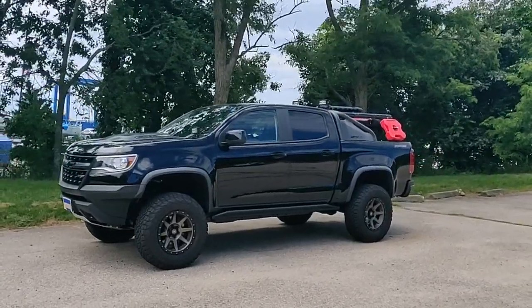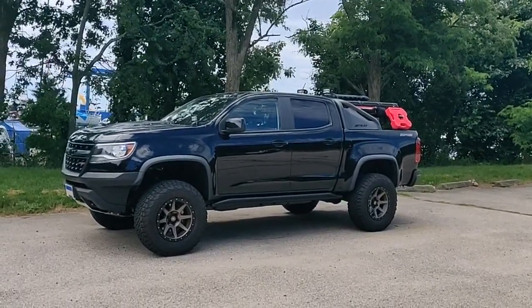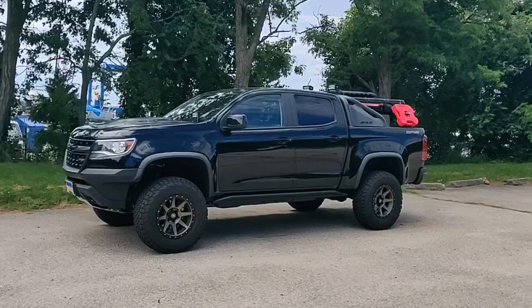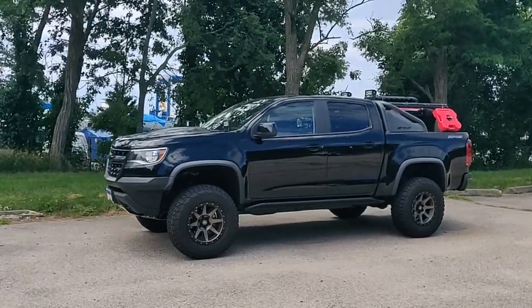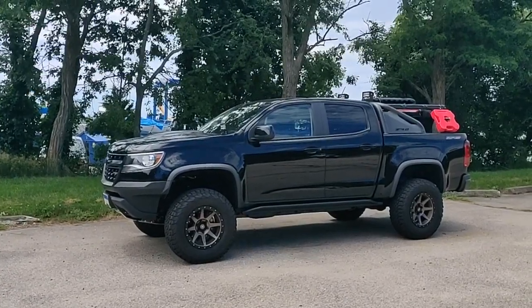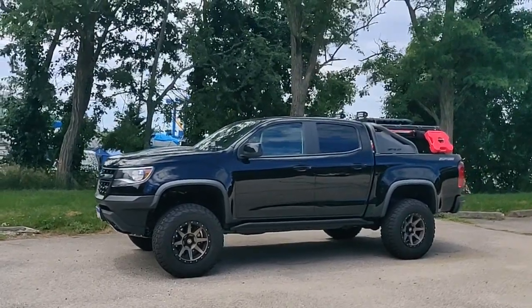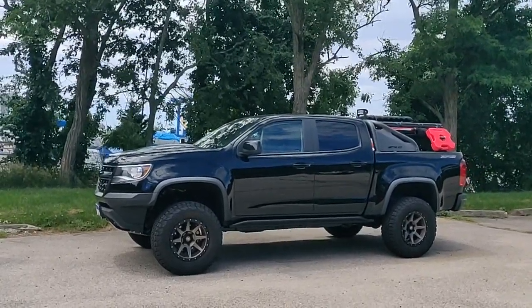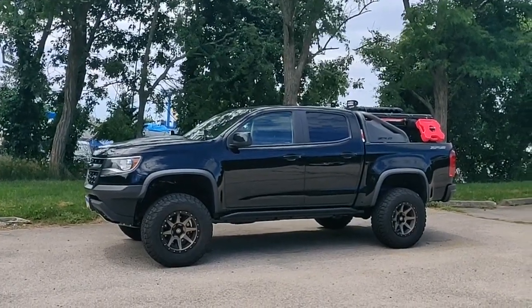It appeared to be plenty of space where I could go up to a size 33 tires, so I had ordered a set of those and then had those installed. But then what I found is the rubbing was quite bad any time on the turn. I thought it could handle a 1-inch increase no problem, but going 1-inch up and then extending out was just too much.